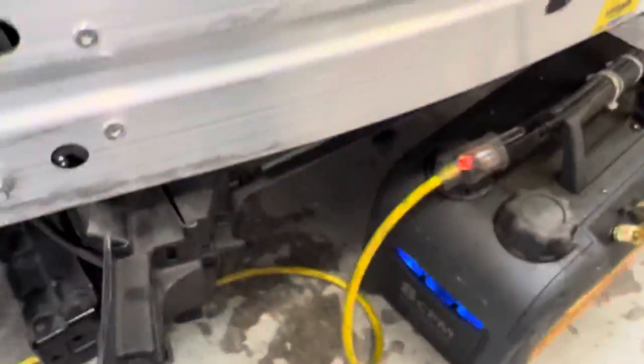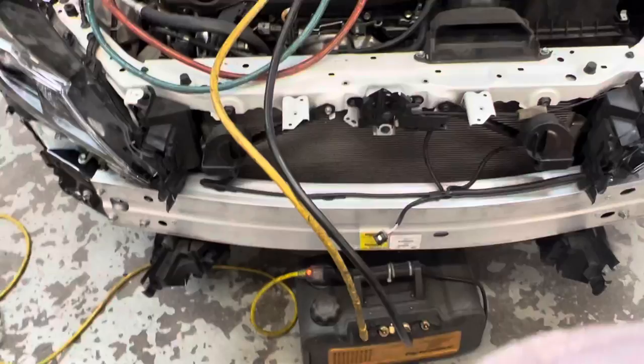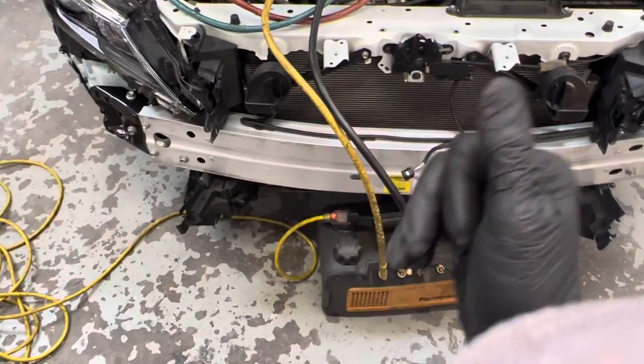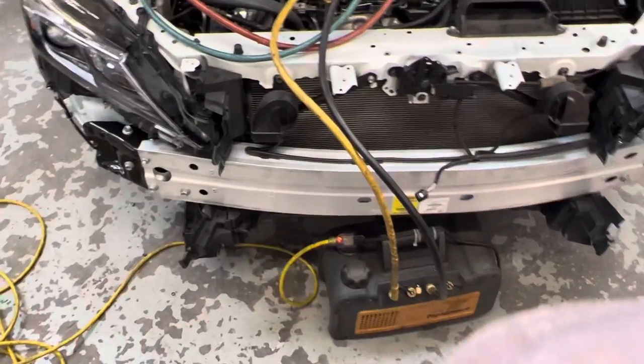And I know he changed the O-ring because he got the OEM Toyota little package that gives you the clip and the two O-rings. So I know he's not going to have a leak, so I can continue on and charge this and not worry about it blowing out — on me or on them later — because of trying to reuse the clip. I don't have to worry, they don't have to worry, and the customer won't be angry later on if it blows out a month later.